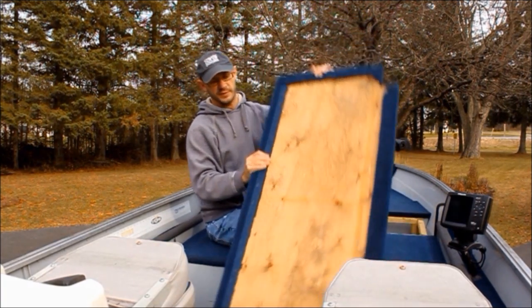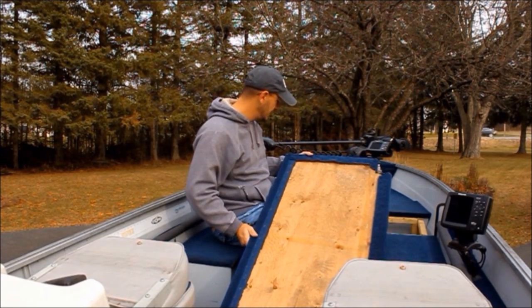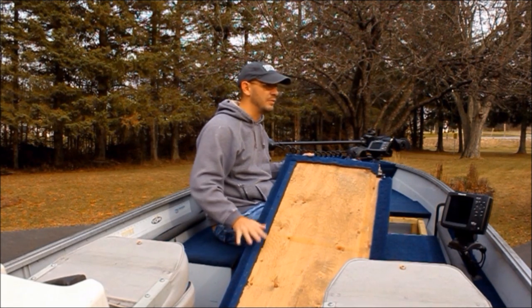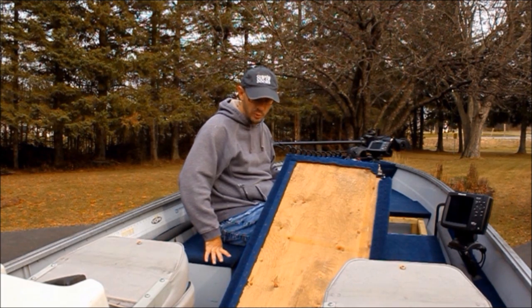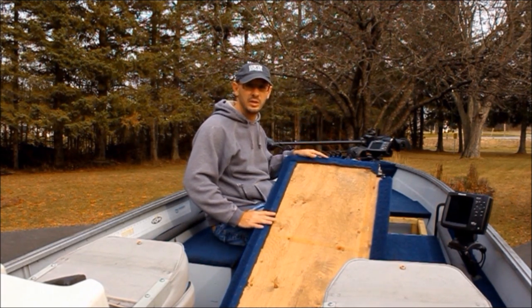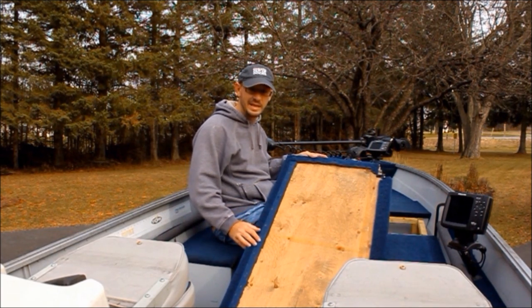As you can see, this is the design we've done. When it comes to installing carpet, it's very important to use marine grade carpet. Don't use any outdoor or indoor carpet. Go to a specialized dealer, marina, or boating store and get proper marine grade carpet. It's going to last longer — it's got UV inhibitors in it and it will repel stains and water.